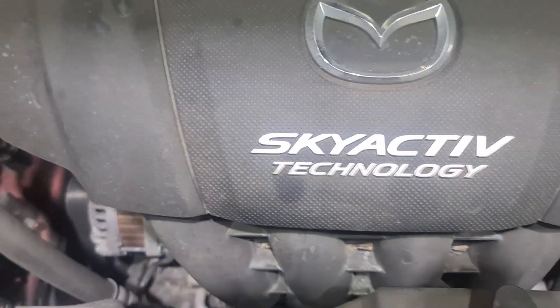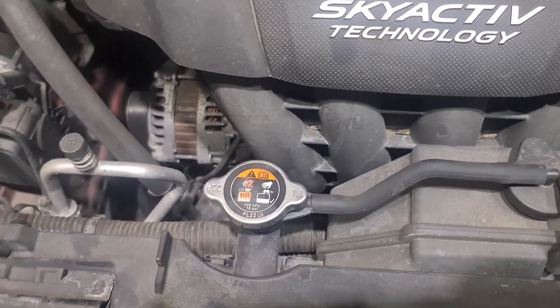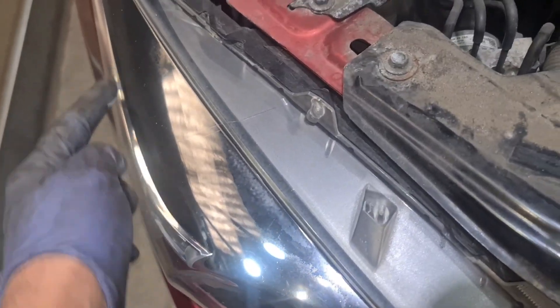Hello from Taj Manor Medics. I've got a Mazda 3 here on a 2017 plate, just doing a headlight bulb on this and the position lamp. The main dip bulb is right there — that's a low beam, that's a high beam, and here is the position lamp around this area here.